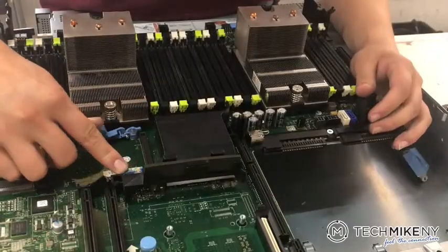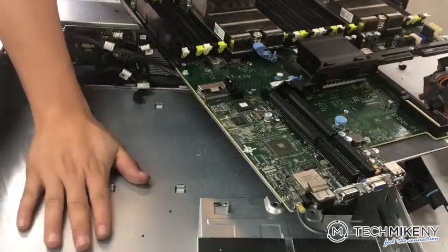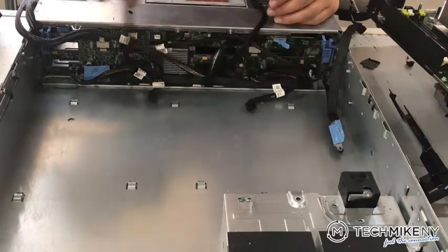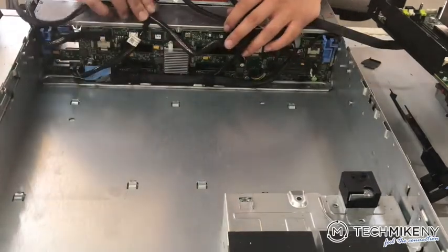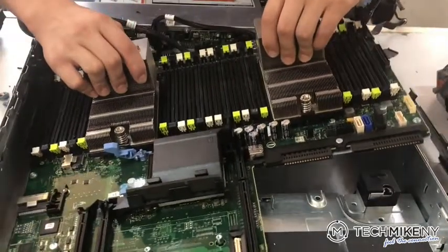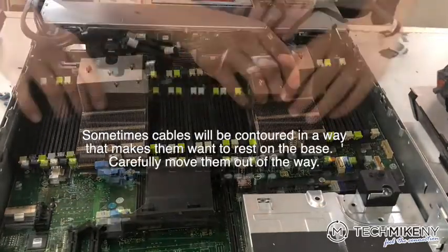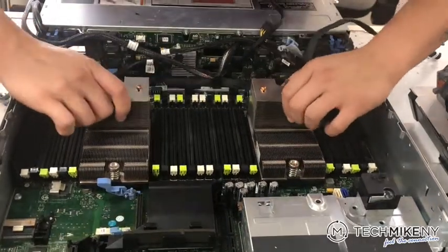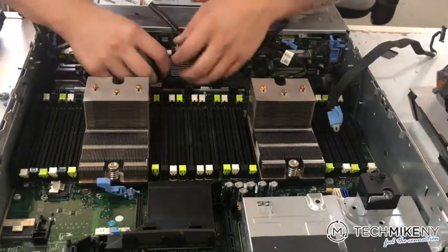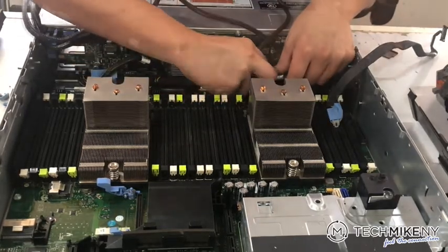Our tech confirms that both clips are secure and functioning. You will then need to reseat the motherboard and reattach all cables and components, taking care to ensure that no screws or other loose bits fell onto the server's base panel. Slide the motherboard back into place. You should hear a click and confirm that the blue pin has recessed back and locked the board in the server. Reconnect all cables and components, retracing your steps from everything you disconnected.